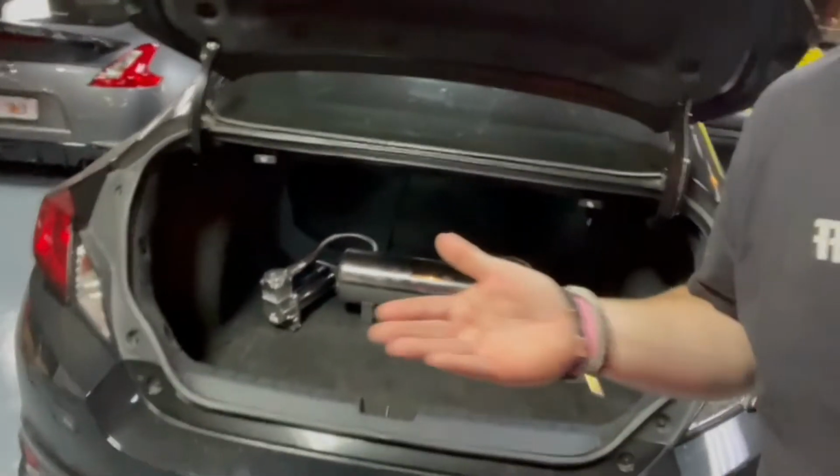Like I said, I have everything wired. I have this wire to accessory in the fuse box. So as soon as you cut on the key, like one turn or push to start, one button, boom, it should come on. And then when you cut it off, it should shut off. Perfect. Like a charm. So the only thing I got to do now is to clean everything up.